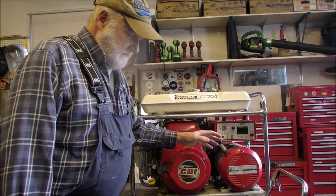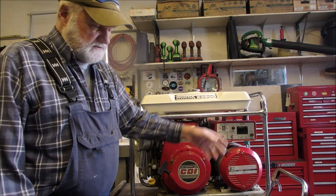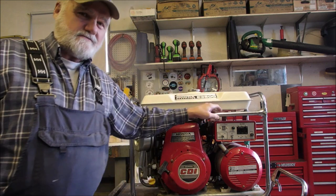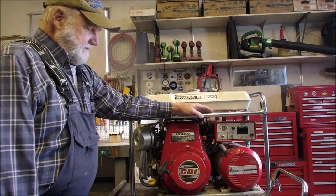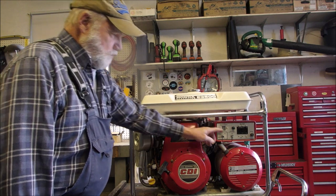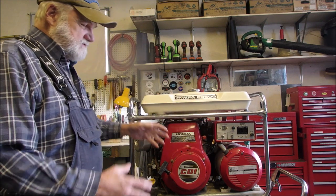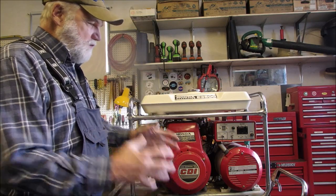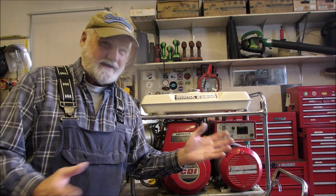You can hear it. And then when somebody turns on a switch or turns on a saw, it automatically, in a few seconds, picks up RPM back to 3,400 or 3,300 or whatever your setting is. And when I hit the switch to idle, it just surged and surged and surged, wide open, nothing, wow, wow, wow. Sorry, I gotta use sound effects.